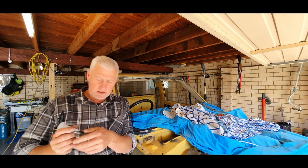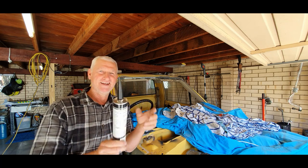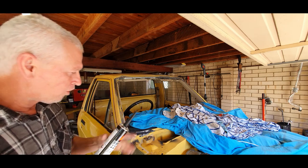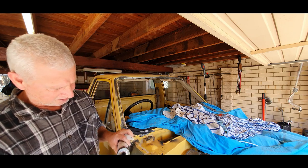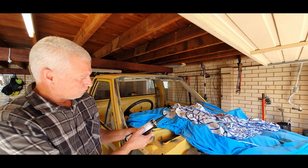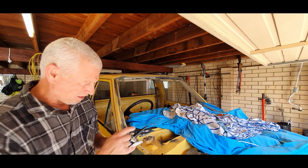We have an issue - I've run out of panel bond. But I do have the thicker curing automotive sealant. Would you believe it - I just took this off. Anyway, that should break off and be usable. The substrate's done, it's solid, so I might use this to fill instead of the panel adhesive - same thing really, it still sticks and adhesives. It says it can be sanded, bonds well to a variety of substrates. I'm going to use this instead of buying another $60 worth of panel adhesive. I've never seen that happen before - at least I can reuse this.